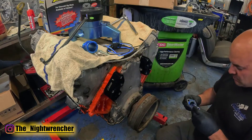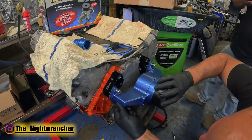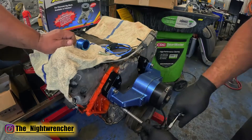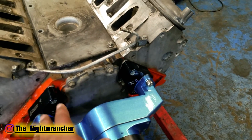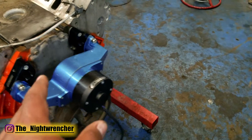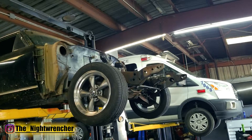This is as clean as this engine is going to get. We went ahead and installed the electric water pump that we're going to be using — this is actually a big block Chevy water pump with a set of ProForm adapters for it to fit the LS. This is just the easiest way to get an electric water pump onto an LS. If you were going to be using this for a daily driver I probably wouldn't recommend switching over to an electric water pump, but we're going to be doing a lot of dyno stuff and it's a lot easier to remove an electric water pump than a standard water pump. We're keeping the factory damper, and the only thing left is to figure out how to install an alternator, but I think we're just going to go ahead and mount the transmission onto this engine and drop it into the 68 Chevelle.